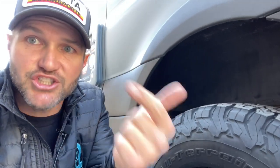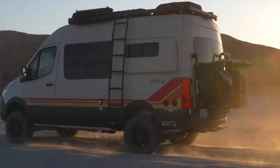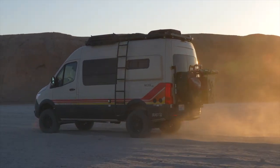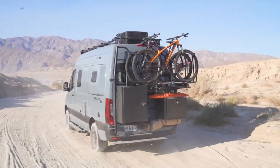The first and most important thing to understand about a suspension is there's a spring and there's a shock. What does a spring do? A spring actually just suspends the weight — in this case a vehicle — above the unsprung weight, which would be axles and tires and these kinds of things. So when you hit a bump, the bump is going to force the tire, the wheel, the axle, everything up. The spring is going to soak that up.